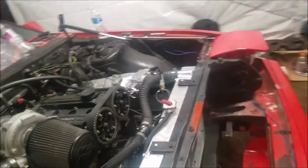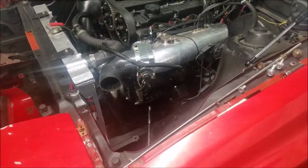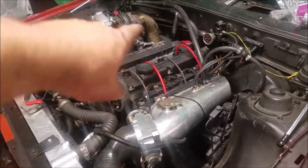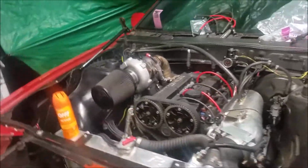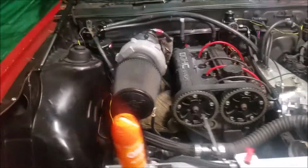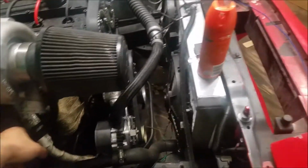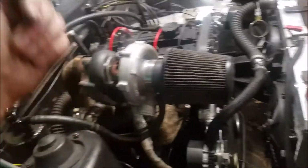Now Paul's just working on getting his relocation figured out down here. So we'll be back when we figure that out. Alright, so got the coil pack relocated down here. eBay screwed Paul, so he's got some random red wires. So we did like black, red, black, red. Then the relocated wastegate. Got the wastegate lines hooked up. The oil feed is straight up and down. We can actually clock this differently now, and it looks a lot better.